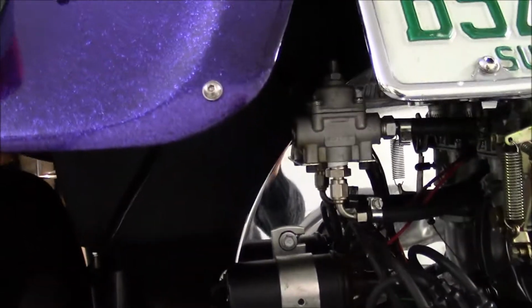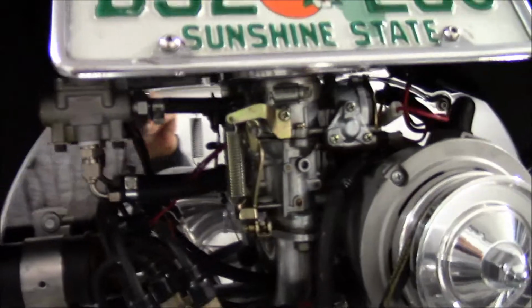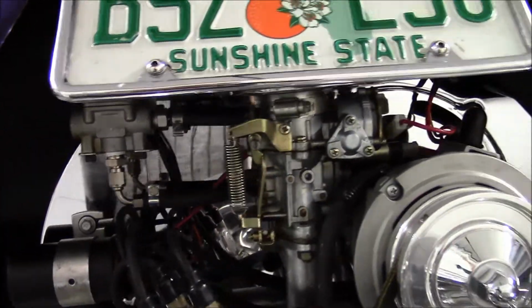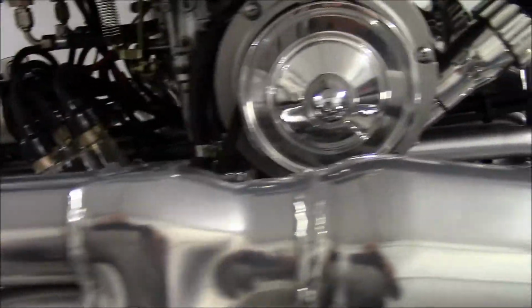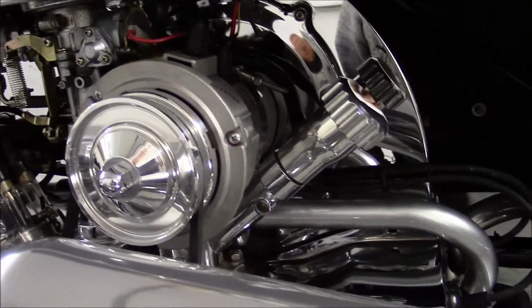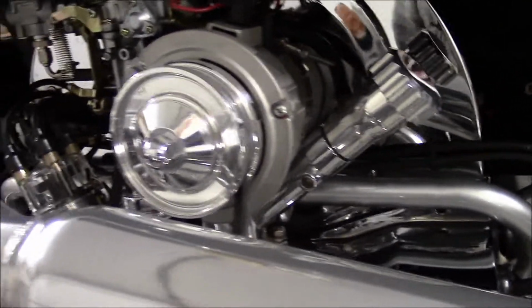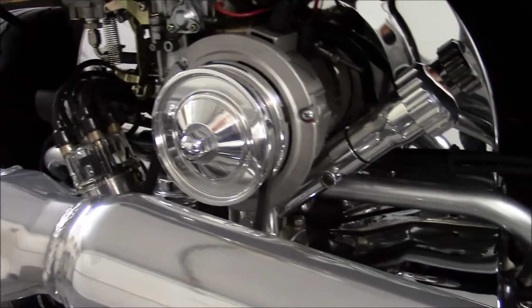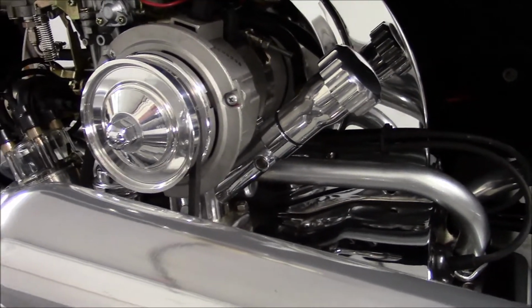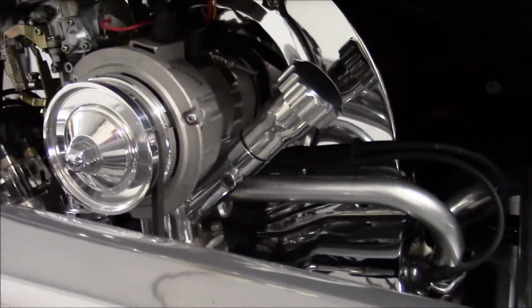I have the engine all dressed up with different pieces of chrome. I have a fuel pressure regulator on it. It's a new carburetor. The billet aluminum alternator pulley. It's a 1600 single port engine. It runs perfect. Doesn't leak a drop of oil. Neither does the transaxle. That does everything exactly right also. There's also going to be an engine running video after this video you can watch.